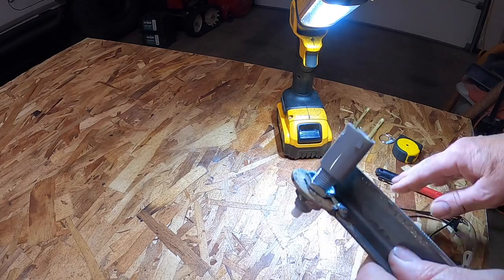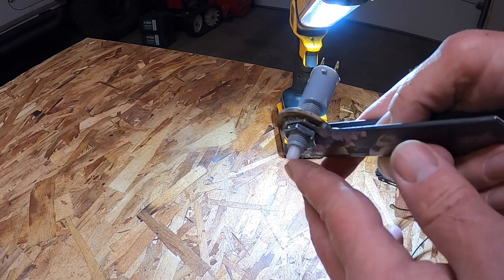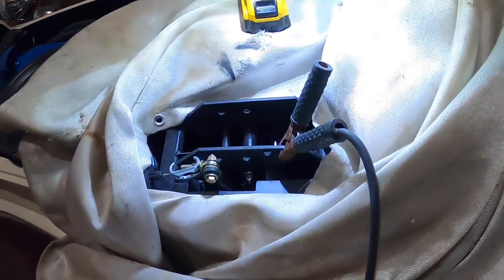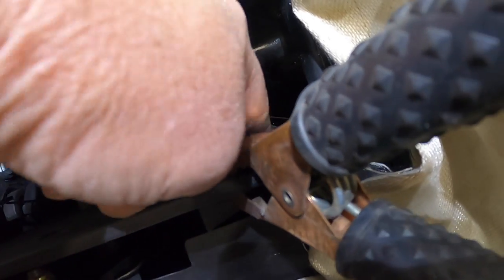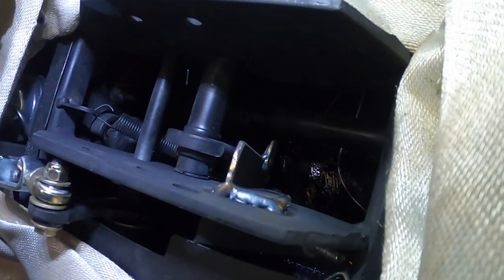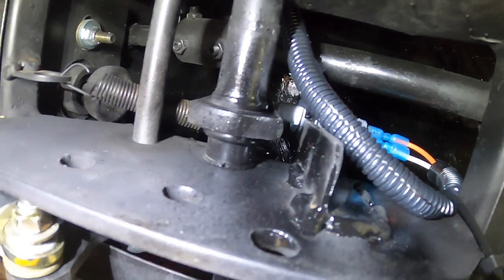This is what it looks like with the switch in. I'll weld this on the top bracket of the brake pedal so the plunger pushes in and the brake light comes on. All draped up and ready for surgery — here's the bracket. I'm putting welds along here and on the inside; that'll hold it. Then I put the switch in. All welded in and ready to mount the switch. Here's what it looks like with the switch installed, just touching the brake arm.